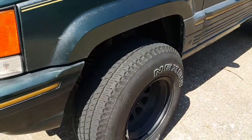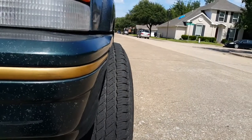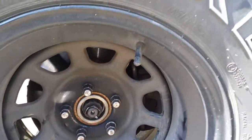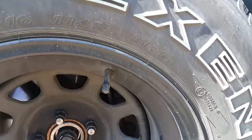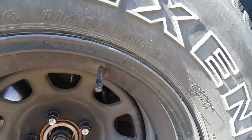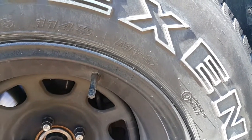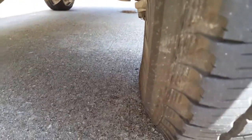I'm starting a new project to make the front axle wider. My backspacing is set so that the wheels have a huge recess, meaning the wheel is offset from the centerline of the axis on which they turn. This is a problem because the centerline should be close to the center of the contact patch of the rubber on the road — here it actually touches the road.